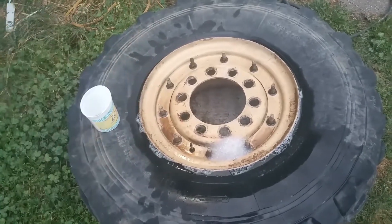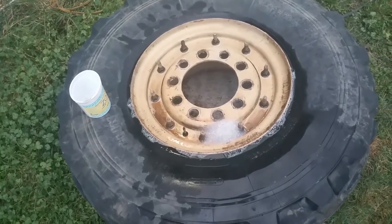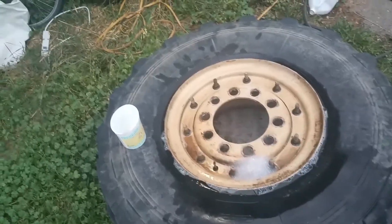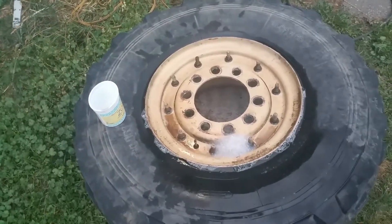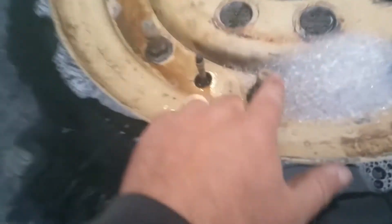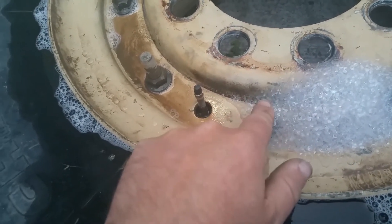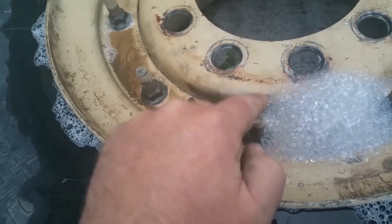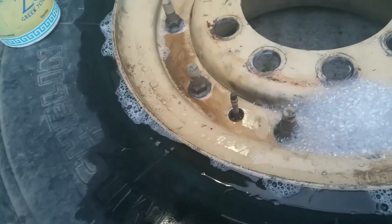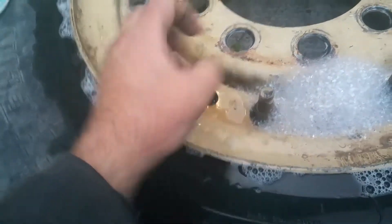You've seen it so many times I don't know what I can add to breaking down the tires. If it's the first time the tire's been apart in many years, it's going to be rough. This one was apart like five weeks ago, so it's not going to be so bad. Get the tap that's the right size — I have a video on this. If you've got paint or rust, run the thread chaser down on these; it is so much easier. Make sure she's totally dead flat, valve core out, before you pull these loose, because boom.